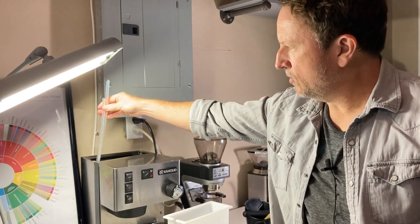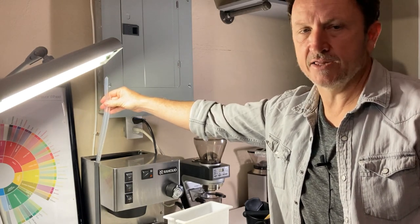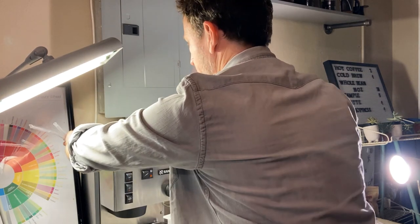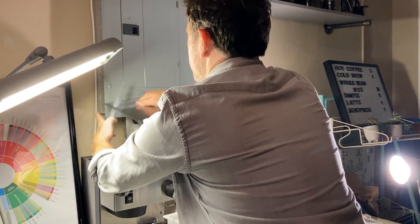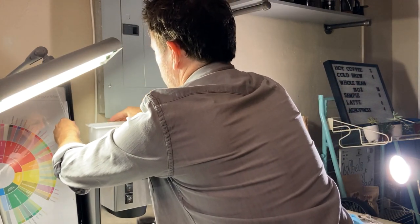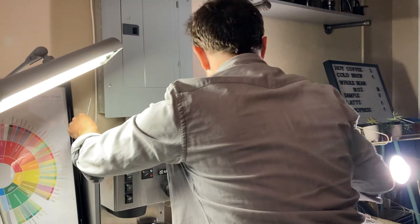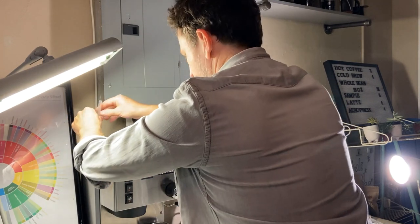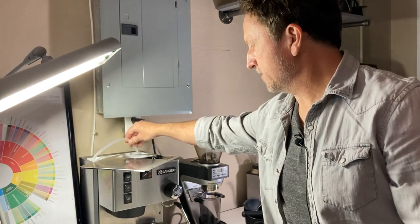As you can see here, there are two hoses — one longer than the other. The hose we need to work with for checking the pressure on the Rancilio is the short one. Sit the metal lid to the side for now. Place your water back inside, because the long hose is what takes the water. The short one I'm going to put my metal tray up here kind of diagonally, because what I want to do is show you how you can weigh the water as it's coming out. This is called the OPV valve.